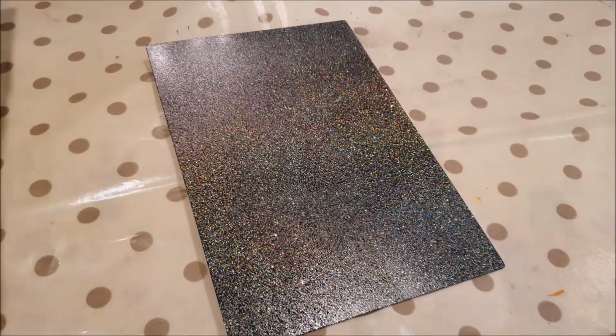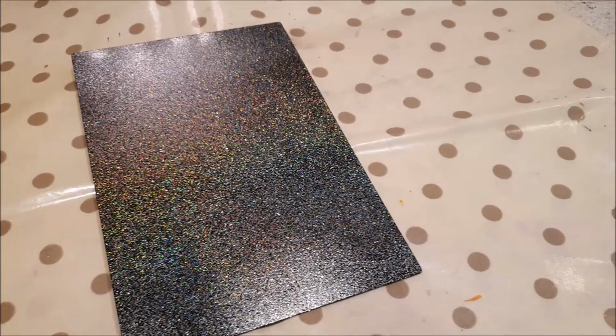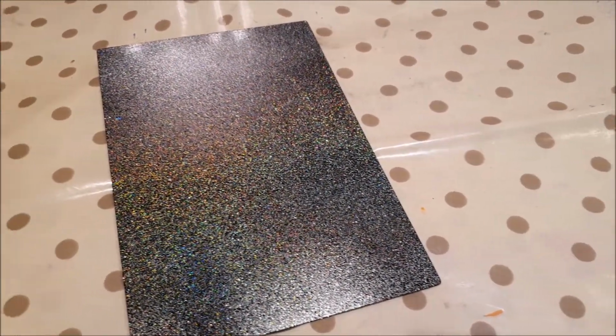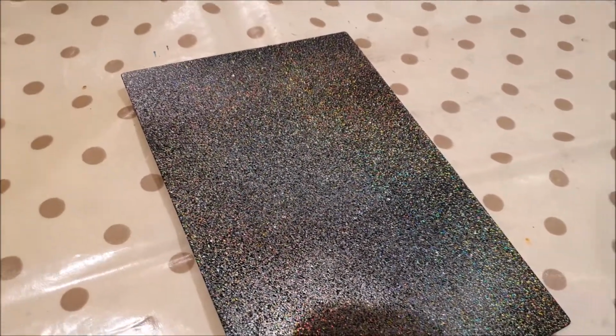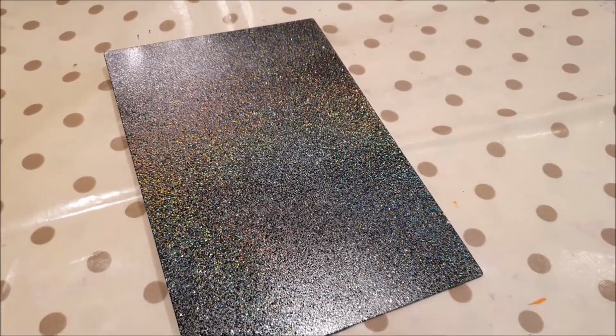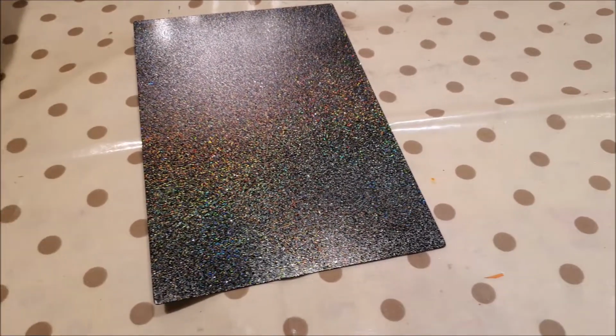So I've got this panel that's already been flaked and cleared over with these silver holographic flakes, and you can hopefully see the colour shift in them. I'm going to start off with that, and what it really needs first is that top layer of clear flattening down a bit. So I'm going to start with some 400 grit paper.